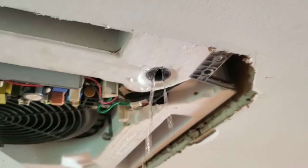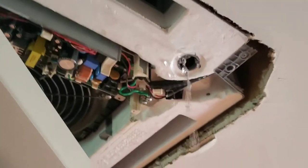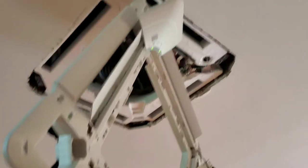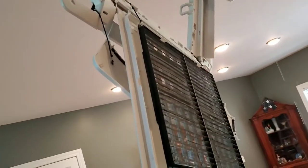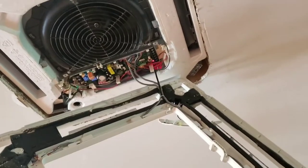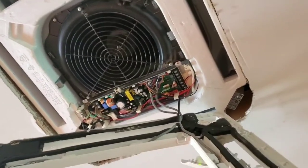These pictures show the pump and the pump removed. Anybody who didn't know where the drain port is on the cassette — that's where it's at if your drain pan's plugged. That right there is the filter and that right there is the front fascia panel. You've got to take both of those off — it has a couple wires that plug into what looks like the receiver. You can see the blower motor, the board, and all that. There's a plug there you can take out.